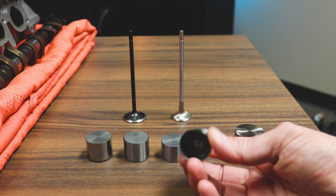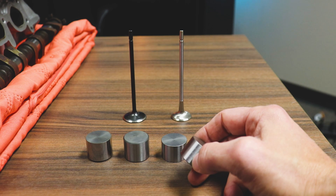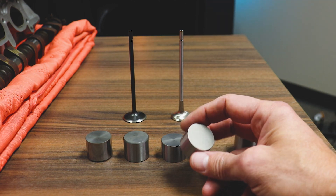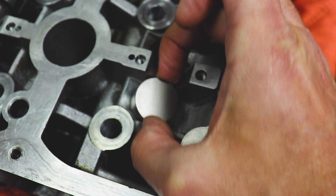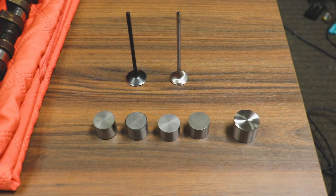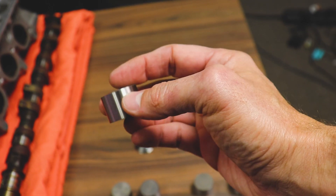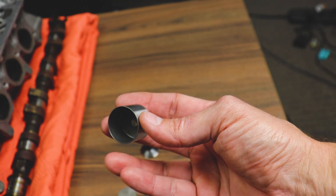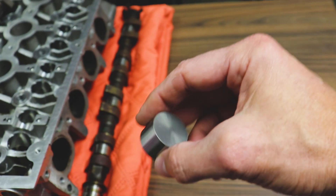Here are all the different types of buckets I ordered to figure out what I can actually use. This one from Super Tech — they were back-ordered on their 28mm. Starting out with my dial caliper, I got a 27.5mm because the measurements were close, but putting it into the bore, just that half millimeter difference — it is too loose and doesn't fit correctly. So my next logical step was to find a 28mm bucket. It fits in there just like it should. However, this was a generic hardened bucket for a CF 250 motorcycle or something like that, and it doesn't work.